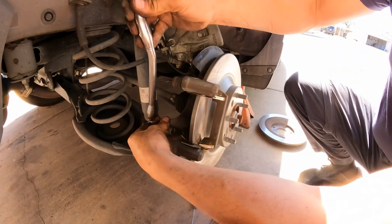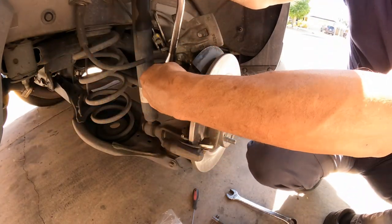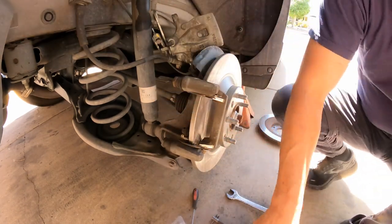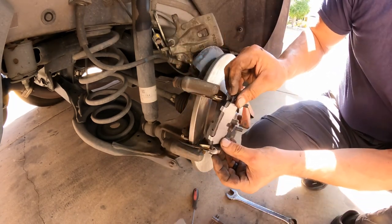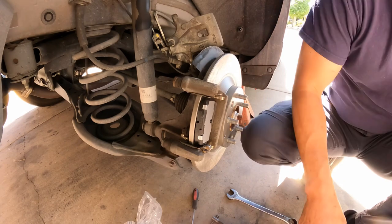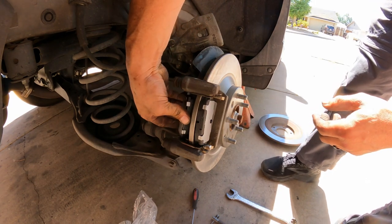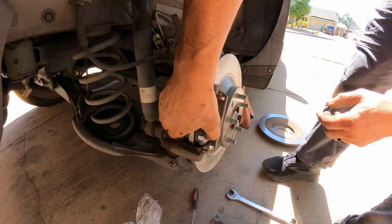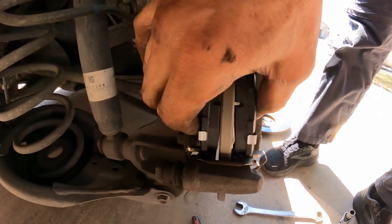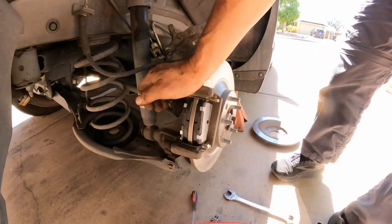All we're going to do is snag this. You'll see the torque specs and diagram in the video. This is going to be the outside — you go like this first and twist it — now it goes on. This is on the bottom, perfect. We do the same thing on the other one — go here and twist it. See how that clip is pushing the brake pad away? That's what you want, so that way it doesn't get stuck and start dragging and wear prematurely. That's the idea.